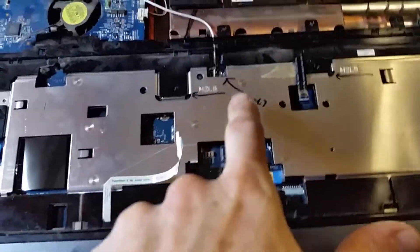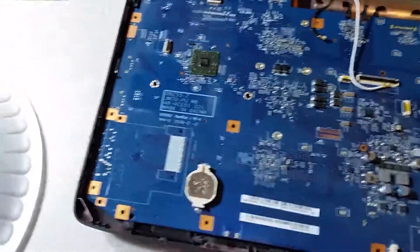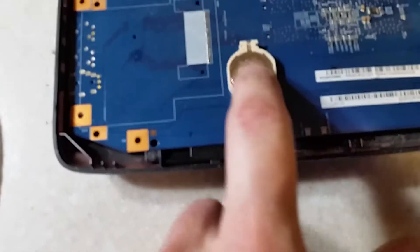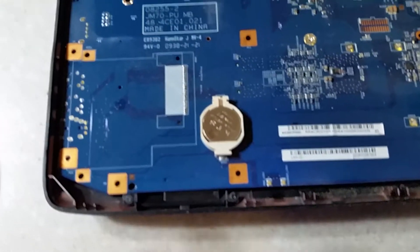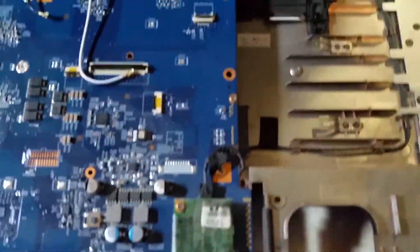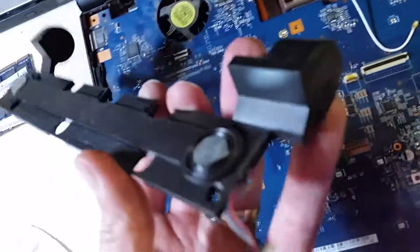Getting deeper now. I've made little notes about where wires go. This laptop has a lot of ribbon connections that I had to take loose all over the place. Now I can lift this panel off — and there's the motherboard. In there is your CMOS battery. See what a challenge it is to get to the CMOS battery? Because every time you turn it on, it thinks it's 1995 or 2000 — the wrong date. That's the CMOS battery; some are easy to get to, some are not. I've still got to pull the motherboard to get down to the CPU and the cooling system. Here's the speaker system — these little canisters give it some bass somehow. Not much of a speaker, but we'll carry on.